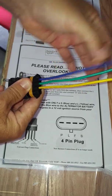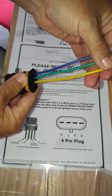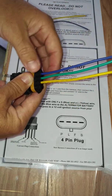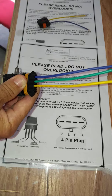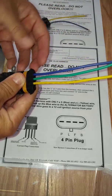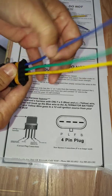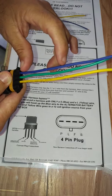Do the same on your stock alternator that's still on the vehicle. Your alternator will be sitting with the regulator facing up and the plug snaps on like this. The codes are on the back. Do the same thing on your car's factory harness — label each wire with tape: L, F, or S. You'll eventually be splicing your car's harness, and we're going to ask you to go about two inches up. That way, if for any reason you want to put your stock alternator back, sell the car, or keep the high-output alternator, it's easily undone. Always label your wires before you cut them.